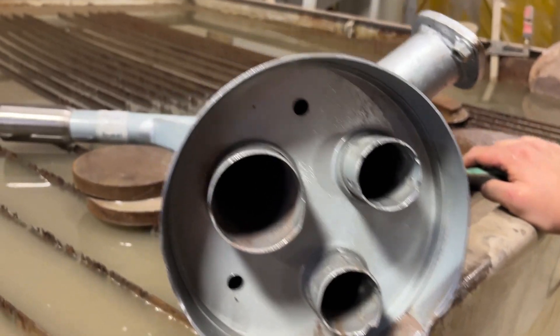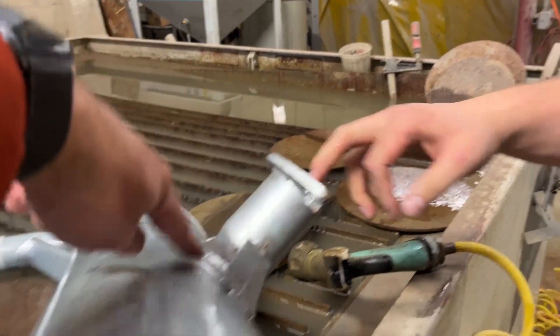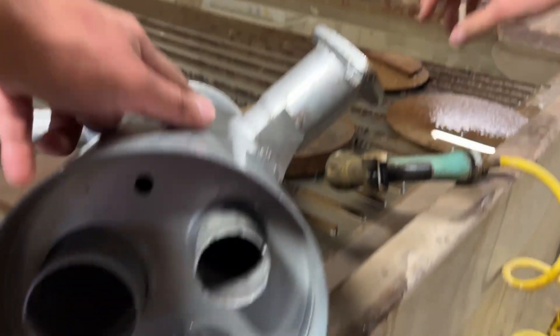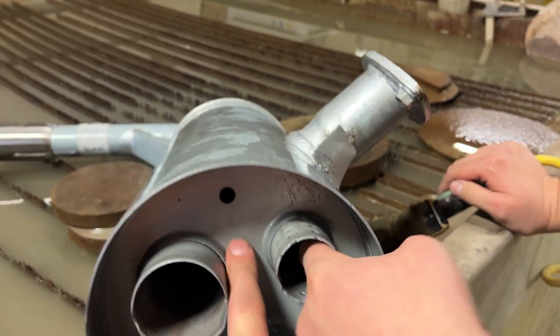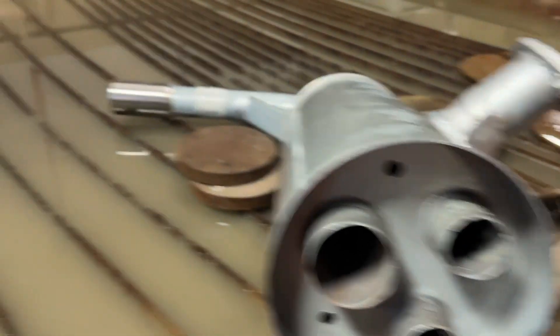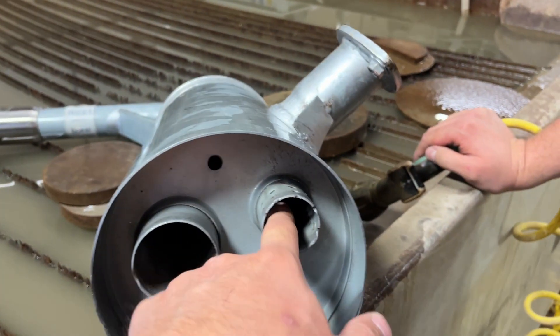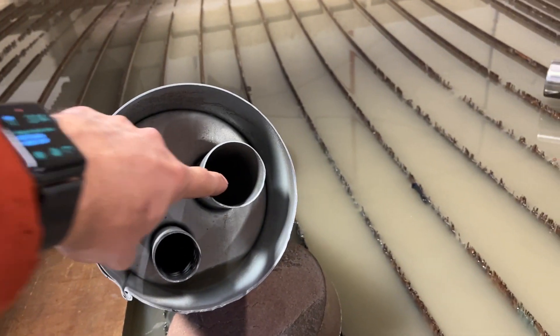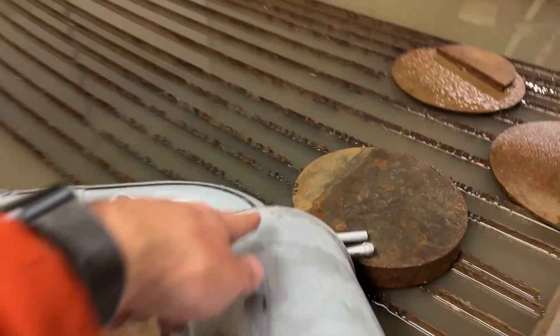Tacos for lunch — taco Tuesday! So how this works is they shoot the sound in here, and then the sound just goes places. It's more than just the sound — it's like all the exhaust too. Sound comes in here and then it's got a bunch of different chambers. They've got chambers separated with these bulkhead-type walls, and then the sound goes through these tubes and eventually works its way to one end of the muffler and comes out this pipe, which then leads out your tailpipe. You could say I'm baffled by the construction. Which one's the chamber of secrets?